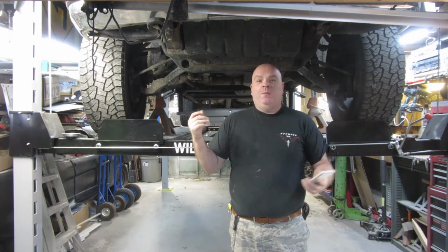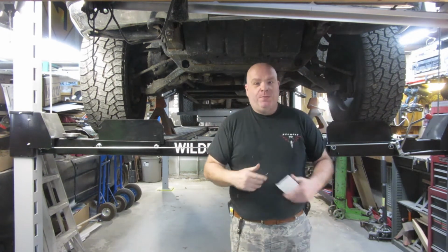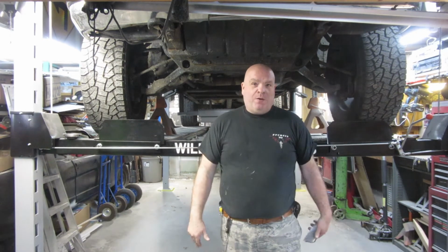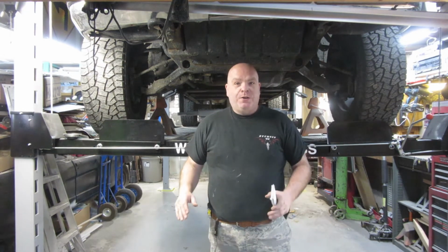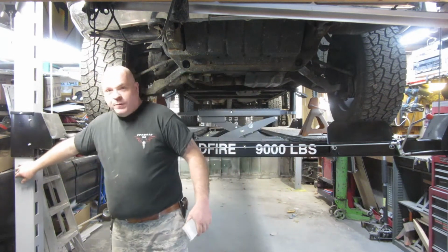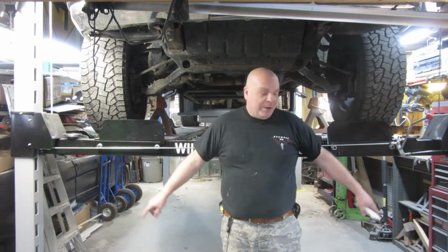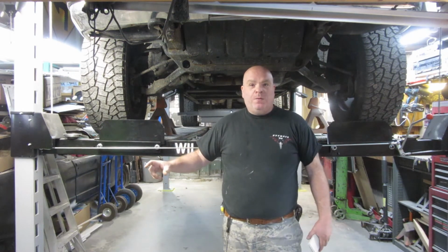Now the door. I would say the minimum door you would want would be a 10-foot door height-wise, 10-foot door wide-wise. That is what I have. And if I put this down on the wheels, I could roll this all the way out of my garage, barely. Because they only give you measurements from the outside to the outside of the pillars, I believe, and the actual measurements come out a bit more, because there are feet on the bottom, another 3 or 4 inches.